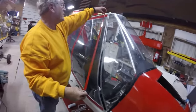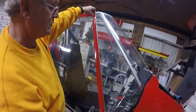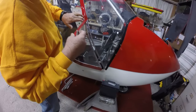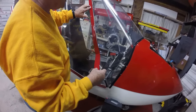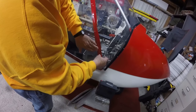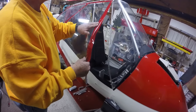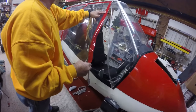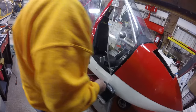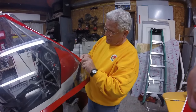They think it's going to be hard to do but actually it's not. What I'm doing now is laying my tape right along the edge of that aluminum tube — that's my marker spot. I'll lay this up here with a little overlap and stick half of it down. I want this to look the same width as this. And 36 inches is manageable — that's why I like that length. You could make it four feet long for fewer seams, but 36 inches is manageable. Your Lexan windshields in normal wear and tear are going to last you probably two or three years, so when you take them off you can use them as a pattern to build your new windshield.